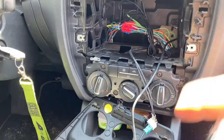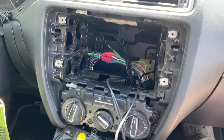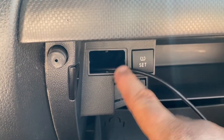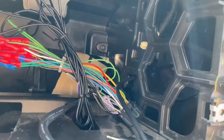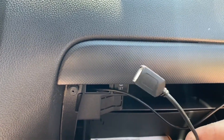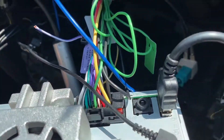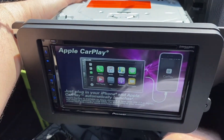There's a USB port on the back of the radio, and Pioneer sent a USB hookup to put on the front because they didn't put one on the face of the unit like a normal radio. I ran it through a small hole in the dash — there's a little knockout plug similar to the one here that I punched out and found where it came through inside. When it's all cleaned up, the USB will be in my glovebox rather than dangling around. Once all wires are situated — antenna, wiring harness, USB, and mic — it's time to reinstall.